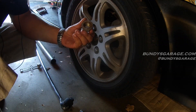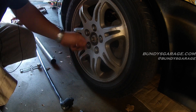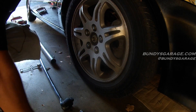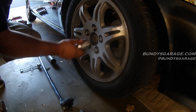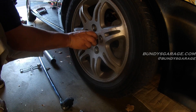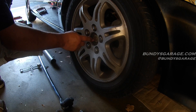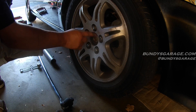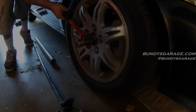That's a good little gun. Next thing you need to do is put the nut back on until the outer part is flush with the axle, and then take a hammer and smack it back in, because you want to break that axle loose from the inner hub before anything else. There's enough room in the axle for it to move just a little bit. I put the axle nut on because I don't want to mushroom out the head. You can also take a chisel and a drift punch and smack it right in the middle — especially if you have to turn this in for a core, you don't want to mushroom out the end of the spindle. Go ahead and just hit in the center.